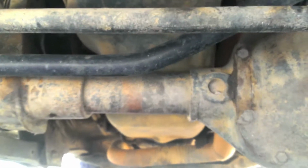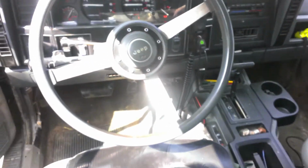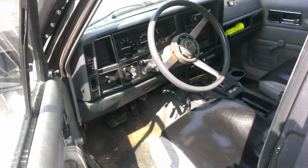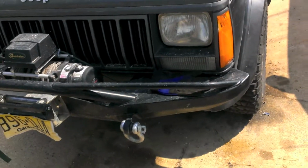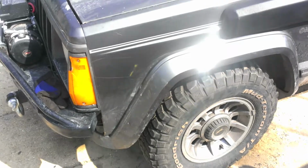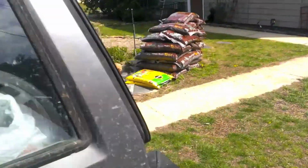Now I previously kept going forward and backwards in the driveway to make sure that my front wheels are properly straightened. And if you notice, for me, that's properly straight. So you notice my wheel's a little sideways. This is how you adjust your steering. Since I'm figuring I've got a loose ball, I'm gonna put the new joint in there and see what that's looking like, and maybe see if that straightens it. And if not, you just bring it one way or the other, tighten it or loosen it, so that your steering is straight compared to your tires. Because I always have to hold the wheel left, so I'm sure there's some kind of alignment issue. Anyway, you ain't gonna be replacing nothing unless you've got a replacement.